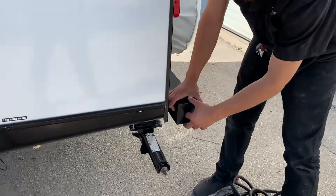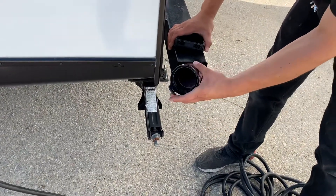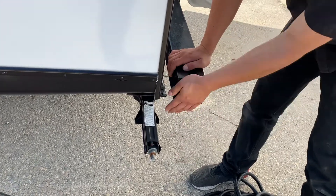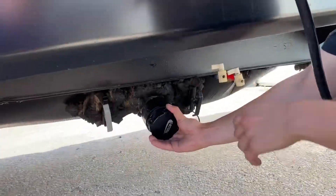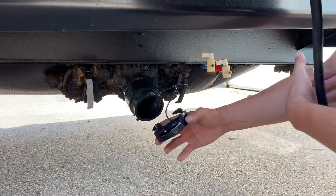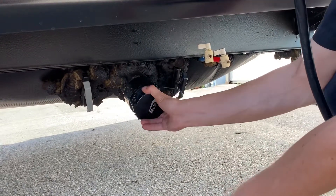Right in your back bumper, if you just pull that plug out, you've got your sewer hose. Take note of those two ears right there, because those are how we're hooking it up. The hose extends out approximately 20 feet. Right down here the sewer cap just turns off — notice the exact same ears there as you had on the sewer hose, so the exact same way to hook it up: just stick it on there and turn it over.